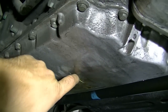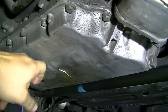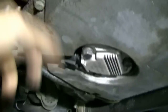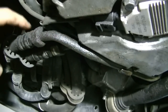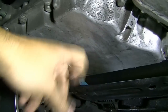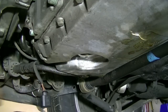There's a crack — this is a pretty big one. They got pretty lucky being able to pull over just in time before all the oil drained out. What we're going to do next is, if you still have oil in it — in our case we don't because it's already been drained — undo the drain plug and remove all the oil. Then we're going to remove the oil level sensor, there's a small bracket on the other side holding two power steering fluid lines to the engine oil pan, we'll remove that, and then we'll go around the circumference and remove all the bolts.